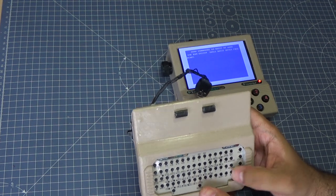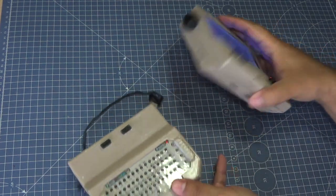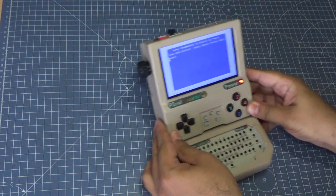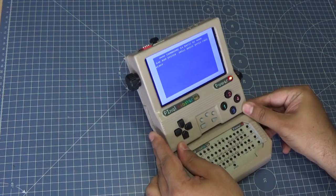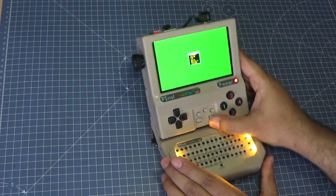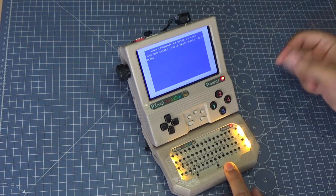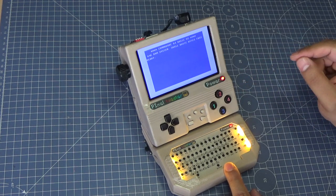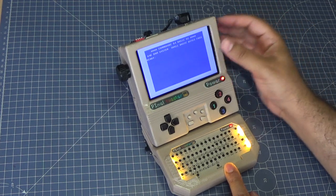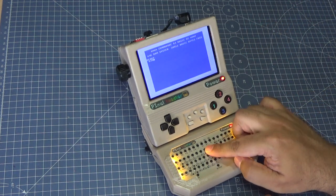The secondary module is this — I made it a keyboard expansion. It is connected with a USB port and through these hooks with that slot. So let me connect it: I insert it like that and push it a little bit to the front to make the shrink fit, then connect the USB input. You can see it has lighting — it's pretty helpful in dark areas or dimmed ambient light. It won't work right now because the emulator controls the USB keyboard on boot, so I turn it off and on to make it recognized.